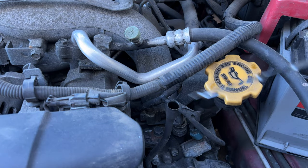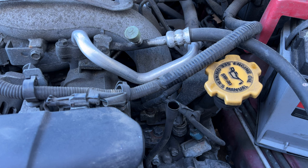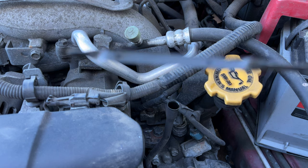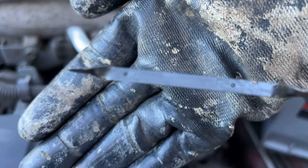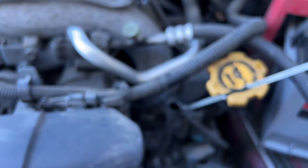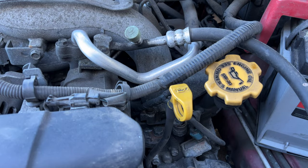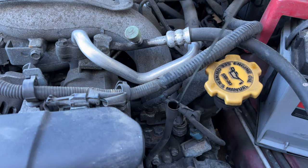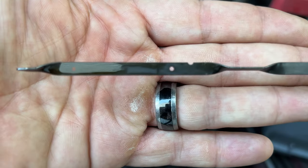So we're going to pull this out — first round we don't even check it, we just wipe off the oil. Get a clean dipstick like this. So you've got a clean dipstick with no oil on there. We're going to stick it back in, let it sit for just a second, then pull it back out straight and we're going to look.